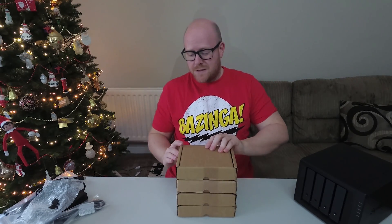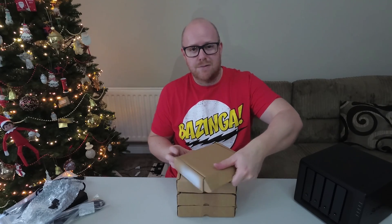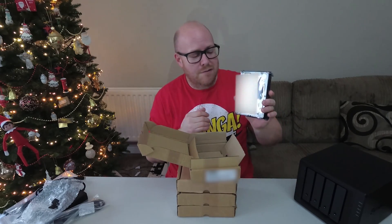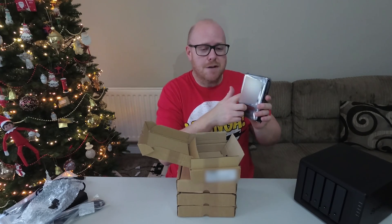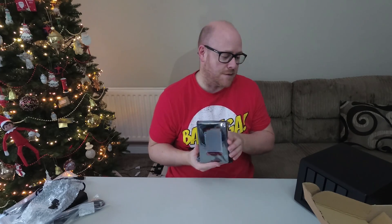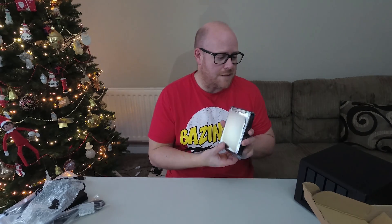I did buy — and I completely recommend this — four 6TB Western Digital Red NAS drives. Some people put Western Digital Blacks and Greens in, but I personally would not do that. These are the later drives with NASware version 3. They're specially designed to be power efficient and heat efficient, since they're stacked quite tightly in the NAS, and they're also designed for 24/7 running.